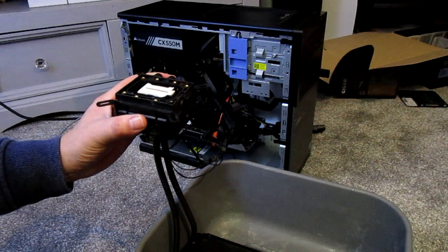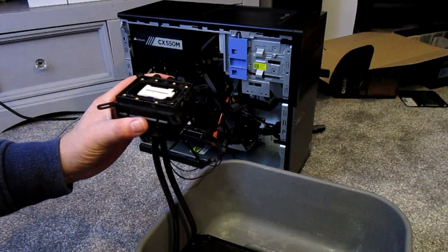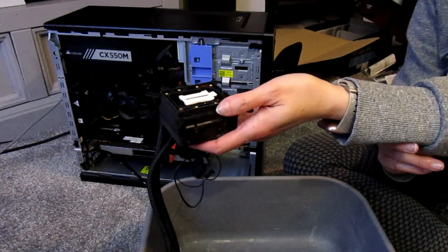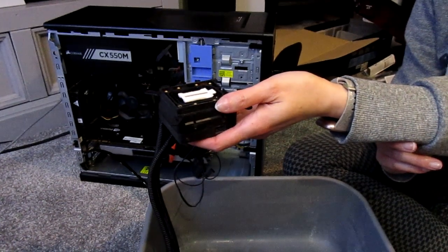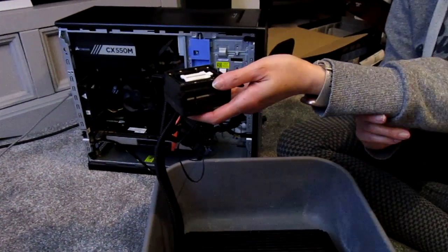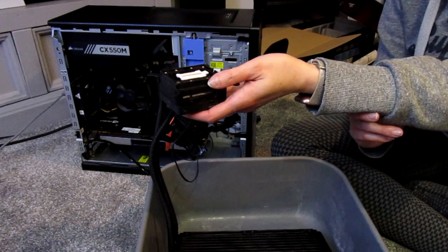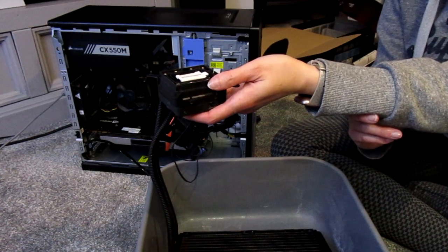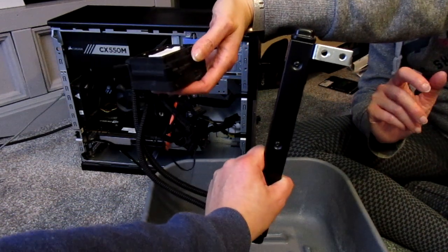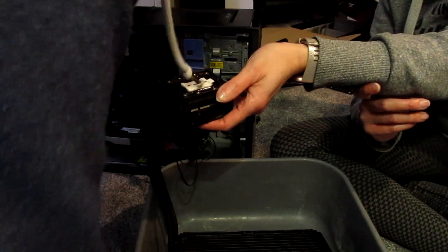Hopefully, all being well with a little bit of messing around, I should have a perfectly usable all-in-one Corsair H100 from 12 years ago. Something the other videos doing this didn't show — when you put your water in, a lot of them say shake it, which does work to an extent. But what I've found with this rad is you put your water in, then you literally stand it up, and then when you've done that for a bit, just lay it back down and it will go down.